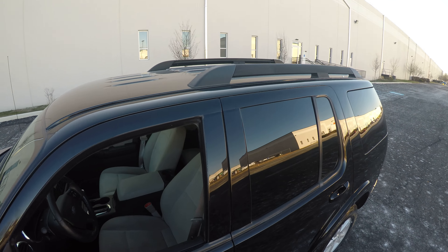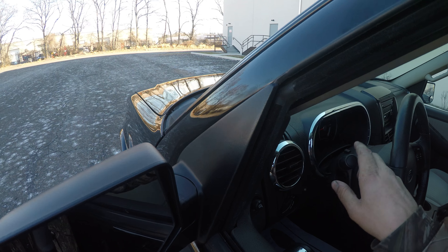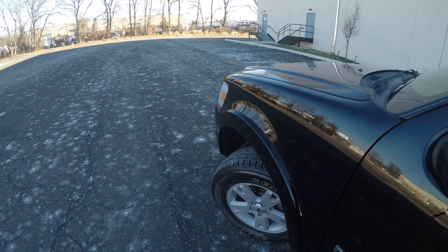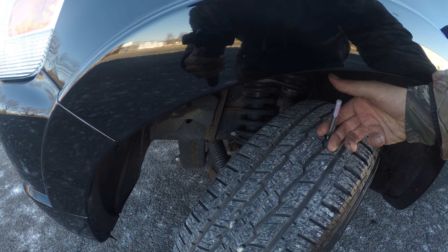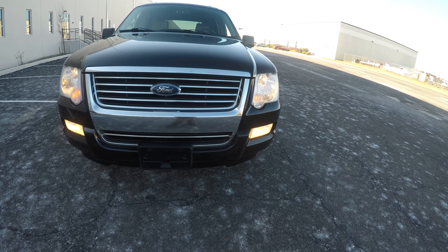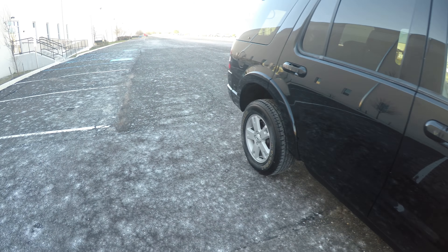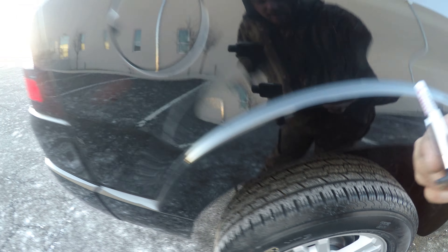The vehicle has a roof rack. Next we're going to look at the lights and tires. For the tires, I have a tool which checks the tread in 32nds of an inch. Our first tire here is 10/32nds of tread. The headlights, fog lights, and left turn signal are working. This next tire is also 10/32nds.